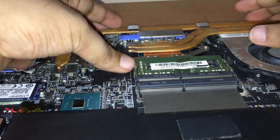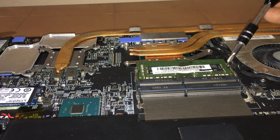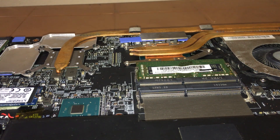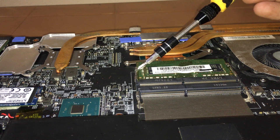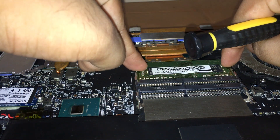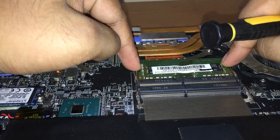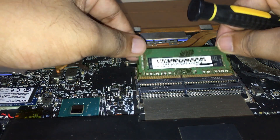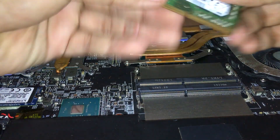You just have to — there are little pins here on the sides, I don't remember the name — but this thing is coupled with the laptop socket. These two pins on the sides, you just have to pull them down and drag to the side, and the RAM will automatically pop up like that. That's how you remove it.